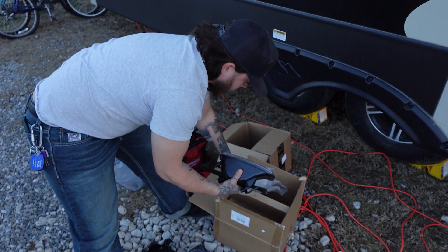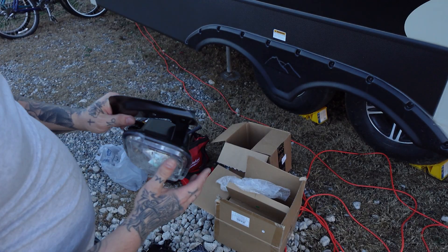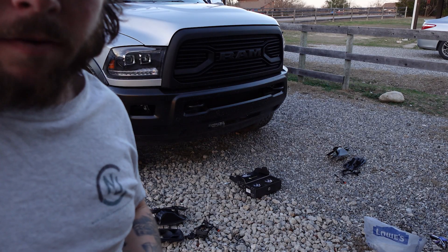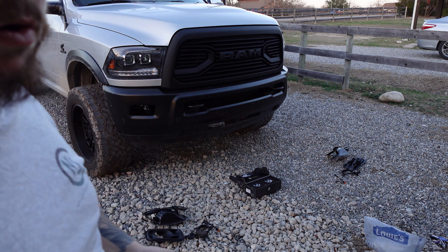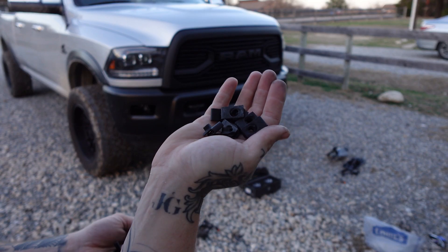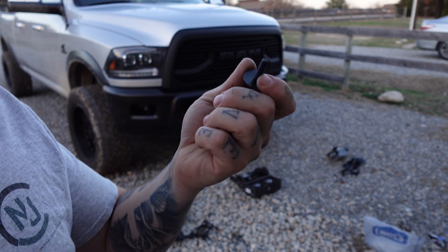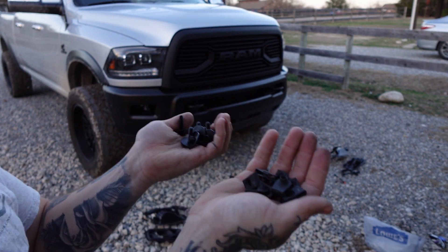We did not have our original OEM fog lights on this truck anymore, so I needed to order some cheapos from eBay. We're going to need the bracket and the adjustment screw to ensure the placement of the lights is where we want them. If you're in a similar situation putting in these Morimoto fog lights without your OEM fog lights, you can get the hardware you need at Lowe's. These are U-nuts — quarter inch — and these are just bolts with extra large washers, quarter inch by one inch in length, perfect for tightening everything down. Plus they're black so you won't even notice a difference.